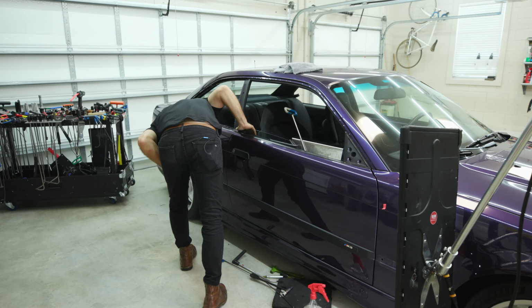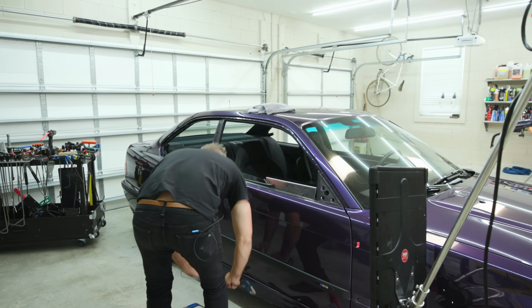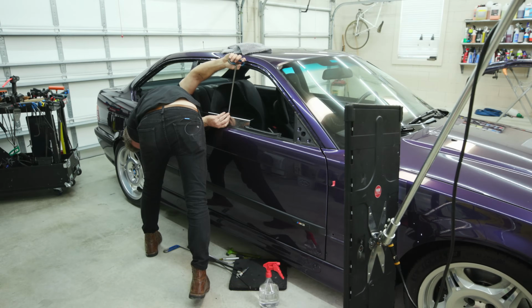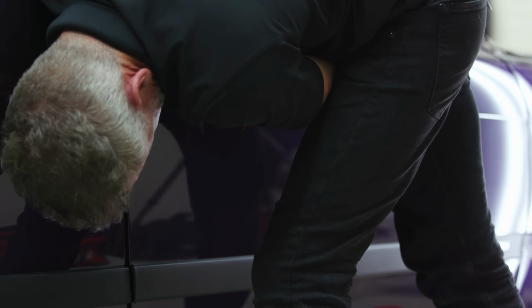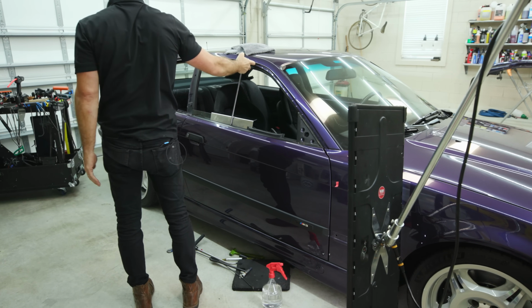So now is the next thing, which is another one of those weird kind of body type things that are going on right there. So I take this out. I'm going to move everything over. So now I'm on that black cardboard fiber board that's on the inside of the door for sound deadening. This is right on it, so it's possible that what makes it look like body work is actually just the fiber board on the inside deteriorating, the glue weakening, and it will suck inward. It will pull the metal inward.